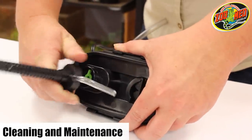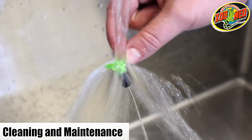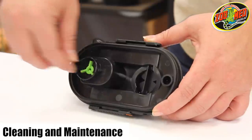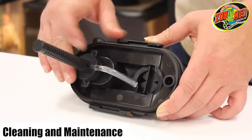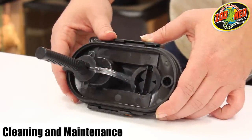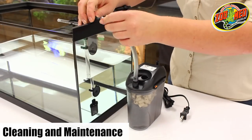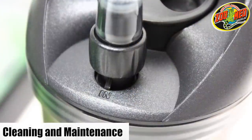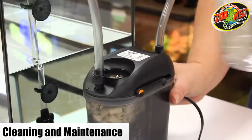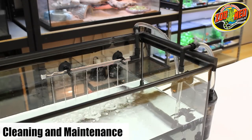To access the impeller, gently pull the impeller housing off and pull up on the impeller. Clean both the impeller and the impeller chamber. Once finished, return all the parts to their appropriate positions and make sure each one is fastened correctly — if they aren't appropriately fastened, the filter may not operate. Make sure the air vent tube is pointing upwards. Lock the filter head back onto the canister and attach the hoses to the intake and outlet units, making sure the intake tube is attached to the side that says IN. Fill the canister with water through the fill cap until it's almost overflowing, replace the cap, plug the filter in, and your filter should now function like new.